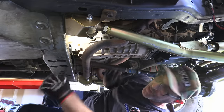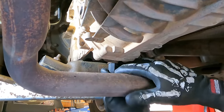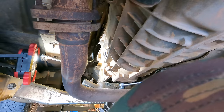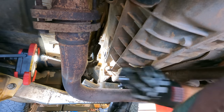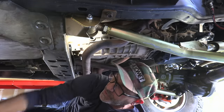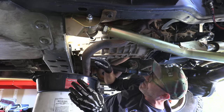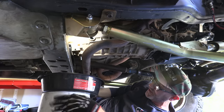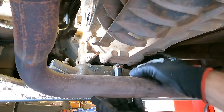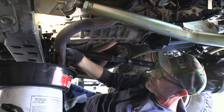The book says to do this at 30,000 mile intervals, so it's time to drain. We'll take our custom allen key, put it in there, then take a 17 millimeter wrench and unscrew the drain plug — that was actually very, very loose. We'll grab our drain tub. A little tip: if you have it sitting on the floor the fluid tends to splash, so give it a little lift. Now just unscrew this with a nice escape plan and let it drain.